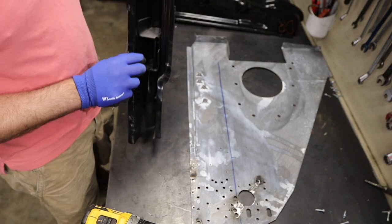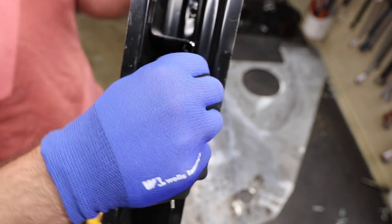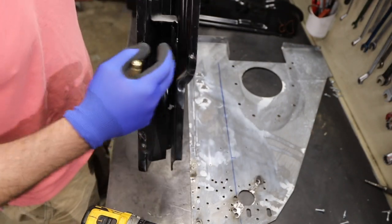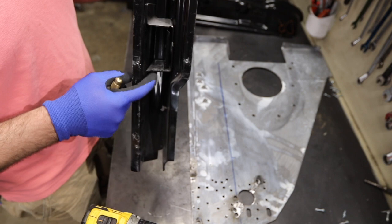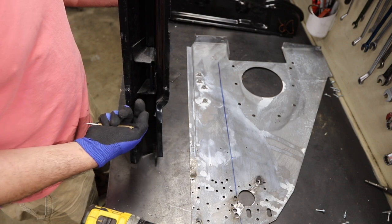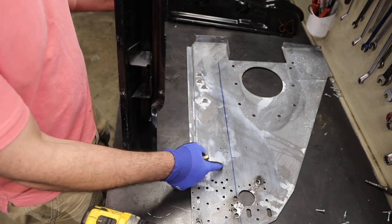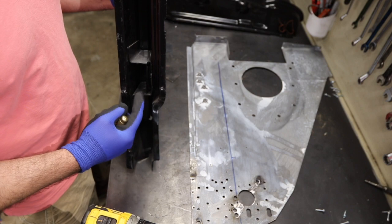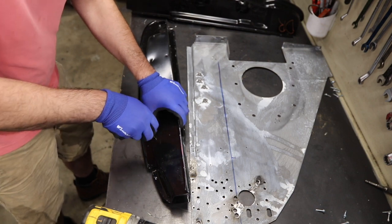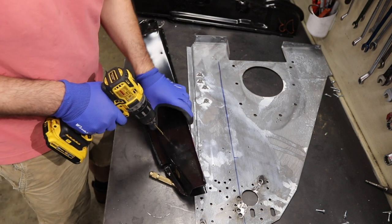So why am I doing this side? These are your captive brackets where the backers for your hinges sit, so you can't open up that side — it's got to be this side where it keys in. I've seen pictures from other vendors where the feet actually come out and attach onto the rocker or the kick panel, but it doesn't matter — they still have the same problem even though the internal construction is different. There are eight spot welds here. I find that if I don't drill a decent pilot hole, the spot weld cutter walks on me.